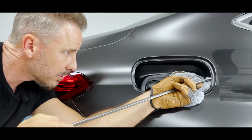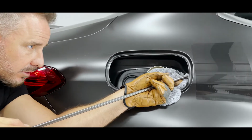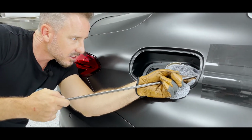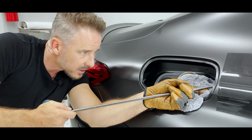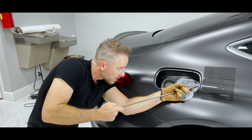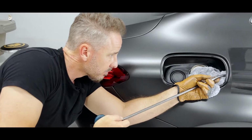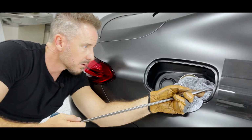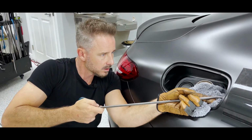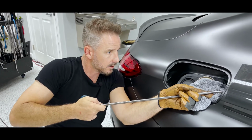So here's where you get the potential to make some push marks, which, if you ever see a dent that's been repaired and kind of looks like chicken skin, you guys can imagine that. Kind of bumpy and big pored, and it's really from too much compression, metal to metal, and then dispersed off. If your pushes aren't tight, your gapping's off, you're gonna get a bad paintless dent repair.